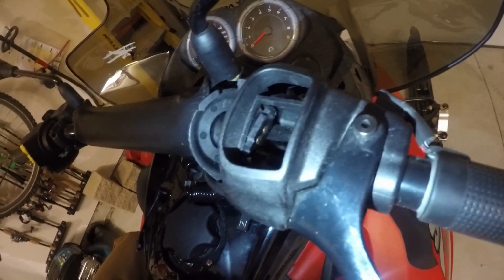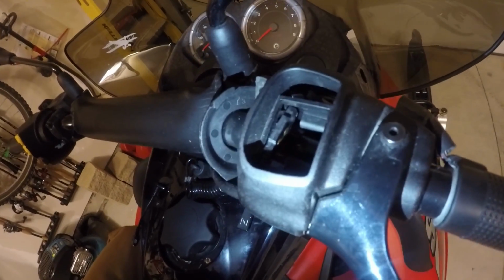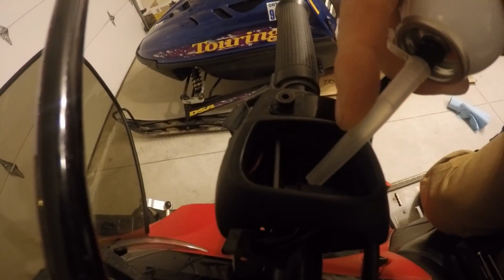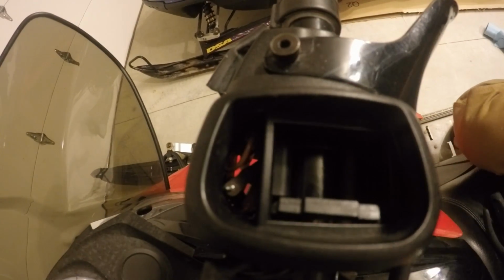And then applying a light coating of dielectric grease as well to the contacts, to prevent future corrosion, make sure the parts are all moving very well, and dielectric, of course, so that it's insulating. It's not going to spark or have those bumps jump from one to the other.